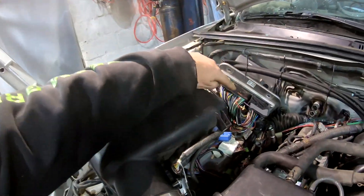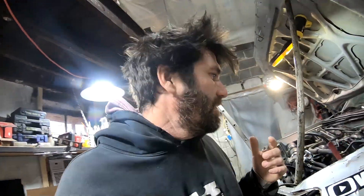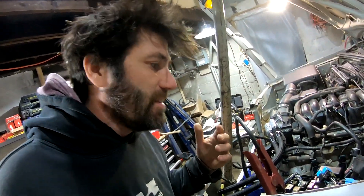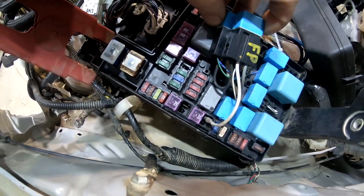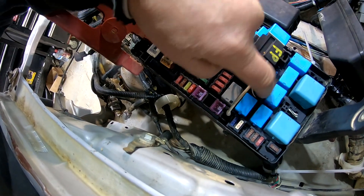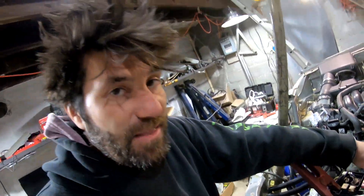There was another wire that came loose in here from the crash this thing was in before, so I fixed that. I also started looking at the fuel pump wiring and determined that to make the fuel pump work like it was in the Tundra, I'd have to jump these and run a Tundra fuel pump relay and circuit opening relay. So I rigged up — actually it's pretty sweet, lays right in here — it pins in where the relays would have gone for the Tacoma, but these are the Tundra relays wired just like they would have been in the Tundra. But the fuel pump still runs constantly.